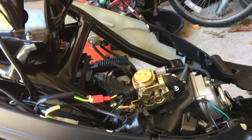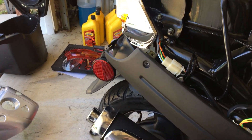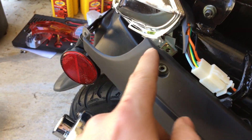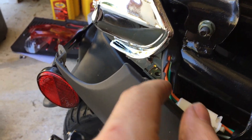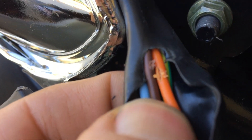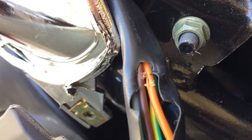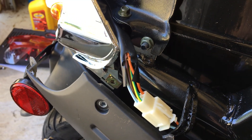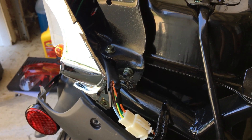I ended up not even having to use the multimeter, because once I took off the seat and the rear basket and cover and all that, I noticed where this screw goes through to the light housing — this wire was actually tucked behind it, and there was a hole right here. It was actually grounding out into that wire. So I'm thinking that's what was causing my fuse to blow.